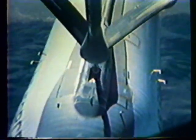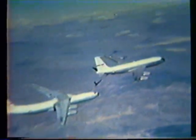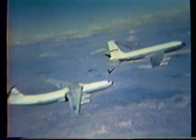The aerial refueling system on the stretched Starlifter provides a means of refueling any or all of the 10 wing fuel tanks of the C-141B from a tanker. The maximum fuel flow rate into the aerial refueling receptacle is 6,000 pounds per minute at a delivery pressure of 55 pounds per square inch. Aerial refueling reduces dependence on overseas airfields, permits longer distance non-stop flights, and shortens closure times for both resupply and deployment operations. Extensive nighttime refueling exercises were included in the flight test program at Edwards Air Force Base.